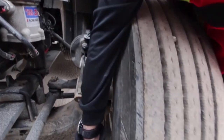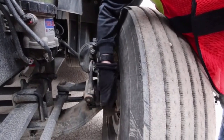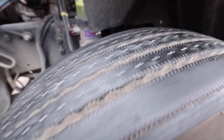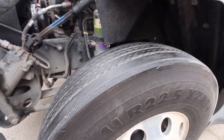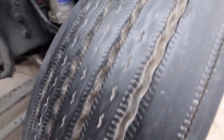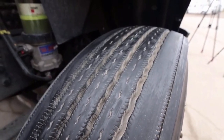For the tires, you're going to check the back of the tire. Make sure there are no cracks, bulges or cuts. The rim isn't bent, there's no welds, and the brake chamber is solid. You're making sure the tread is wearing evenly. In the steer tires, you cannot have less than 4/32nds of an inch tread wear. You're looking for flat spots — is the tire wearing evenly? If any of these problems are visible, be sure to contact Fleet Support for guidance.